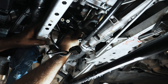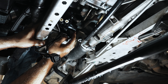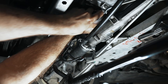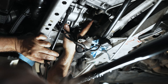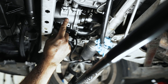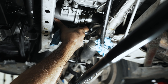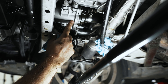There are a couple more clip-on coolant hoses if you want to remove the thermostat housing altogether — it's recommended to do the thermostat at the same time as the water pump unless you've changed it independently. There's one on that side and one down here, then you can completely remove the thermostat housing. One improvement they made over time: there are now rubber isolators built into the water pump so it can free-float instead of being rigidly bolted to the block, so vibrations won't burn out the motor as quickly.